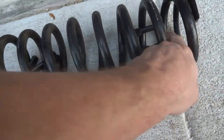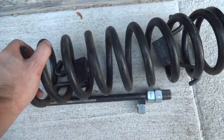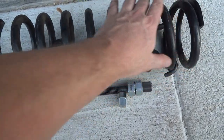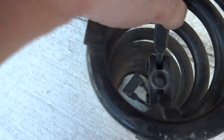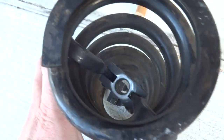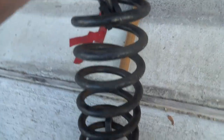The main problem with my replacement springs was that they were longer — even longer than the originals — so I had to compress them down to 12 inches. Under heavy compression, the hooks would start to move: I'd seat them centered to start, then they'd shift to one side. That caused a bulge in the coil — most compressed on one side, bulged out on the other — so it was no longer straight but quite distorted, making it difficult to seat in the shock tower and on the control arm.